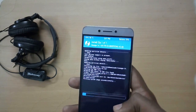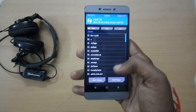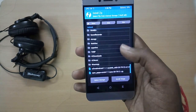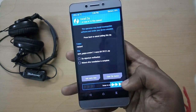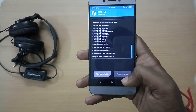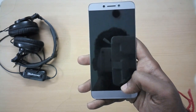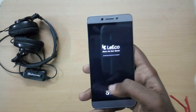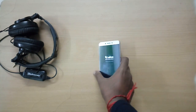Swipe to flash, then go back and reboot system. Remember that the first boot into your newly flashed ROM is going to take a lot of time, so just sit back and relax. Don't panic if it takes more than five minutes or so.